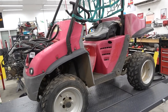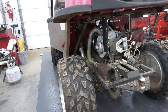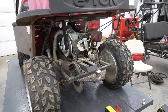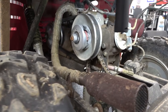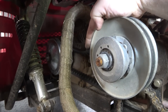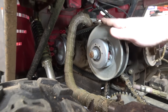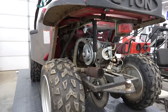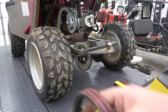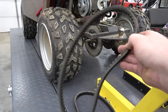Okay so that last segment was filmed months ago and I actually forgot I filmed it. Grayson has been riding it, the brakes have been working great. We just make sure to re-grease that brake mechanism once maybe once a month or so. But it's time for a tune up. You can see his CVT belt is really sitting low in that pulley and there's a ton of belt slop - this belt has definitely stretched out. Grayson does do burnouts - he stalls this thing up to do burnouts in the gravel, which stretches these belts. If you do a reverse gearbox like this, I highly recommend getting the 203-597 belt - I think this is a Murray belt. It's a 30 series, a lot longer belt from Go Power Sports.